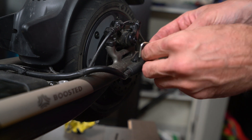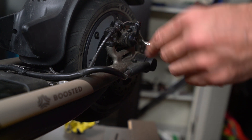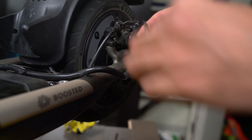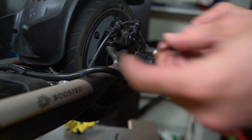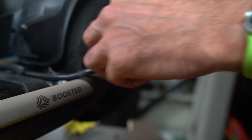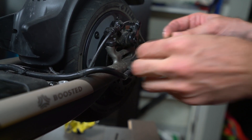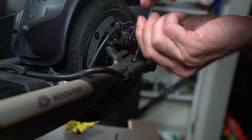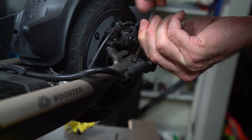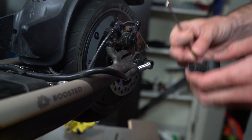This side — last video I took off the caliper, this time I'm going to do it the right way. You should have one of these ball-end allen tools. I actually did have one and didn't realize it. Loosen it first, and then the ball end lets you quickly spin that off the nut. Don't lose that nut — it will come off.